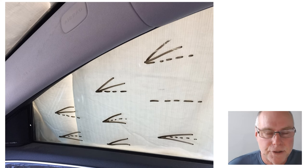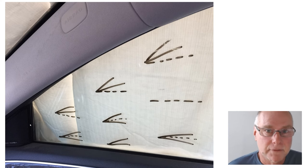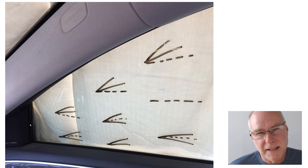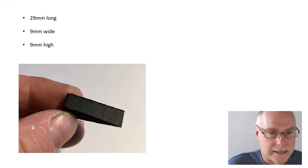Now, is it going to revolutionise your drag coefficient? No, it won't. I doubt it's even measurable. Even in a wind tunnel, I doubt it's even measurable. But is it likely to reduce noise? Yes, it is. It is turbulence, separated flow, which often causes aero noise, wind noise. And I think on some cars, this has the potential to really drop aero noise coming from that side glass. Did it make a big difference in terms of noise on the Mercedes? No, it didn't, but it runs pretty thick glass too. So there's a lot of factors that will actually influence what outcome you get. But it's so easy and so cheap to try and see what results you can actually get.